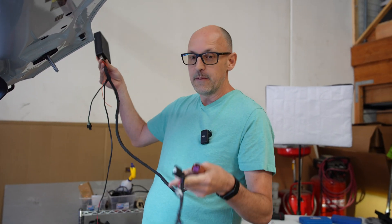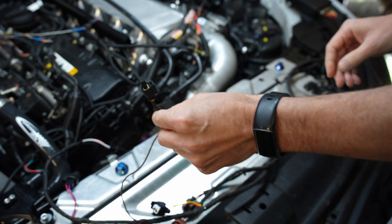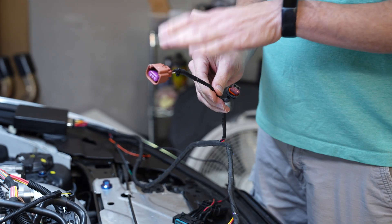The first cars we plan to release this for are the B58 and S58, sharing the same wiring harness. The harness has individual injector controls one through six. There's a cam sensor control input, which is used to time sequential injection — and uniquely, there's no crank position input needed on this harness, because we've come up with a novel way to do sequential timing right off the cam sensor. This makes it super easy to install — just plug it in and you're good. Other systems require digging into the ECU with PosiTaps, which is risky. The harness also has a flex fuel sensor input for full ethanol sensor control, which passes data via CAN bus to your JB4 or flash tune.